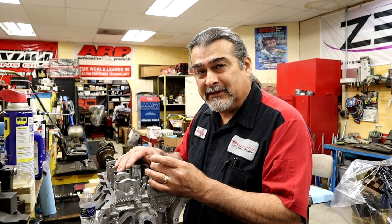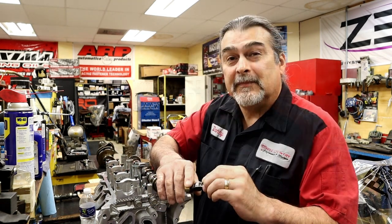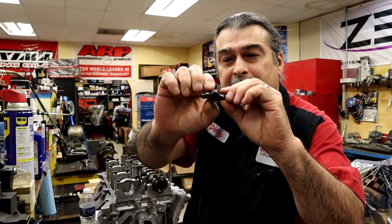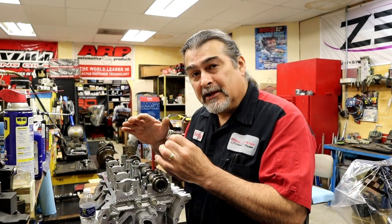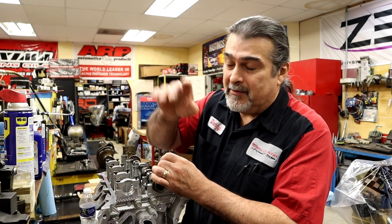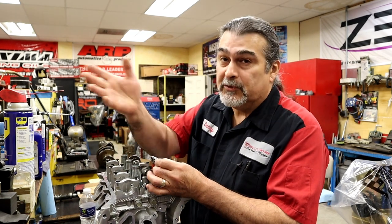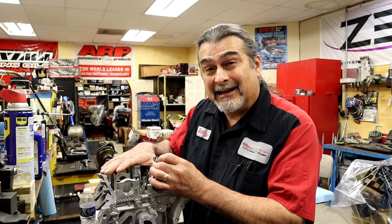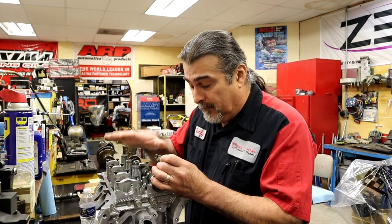Part two is a bonus: have you had problems with your Chrysler V6 cylinder heads with the rocker arms? The issue I'm talking about is the rollers inside — you can see there's a lot of play in there. On this particular cylinder head, the customer had a ticking noise on top. He went and bought a set of lifters and rockers — not from eBay but from Amazon. He put them on, the ticking was gone, but now it had a miss. Check engine light came on, he went to a shop because he did it himself and thought maybe he did something wrong.